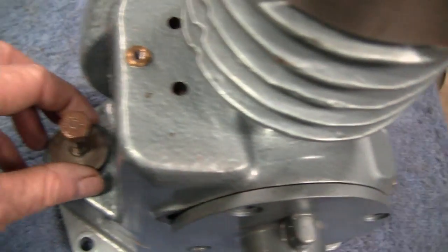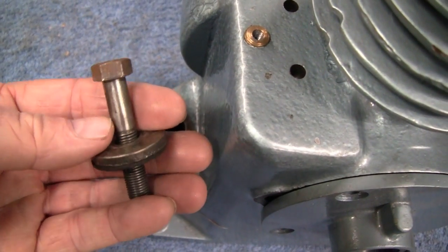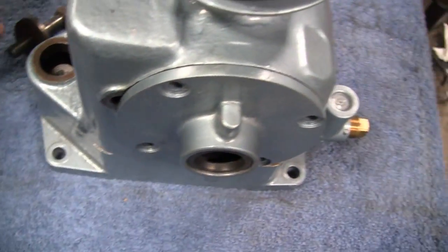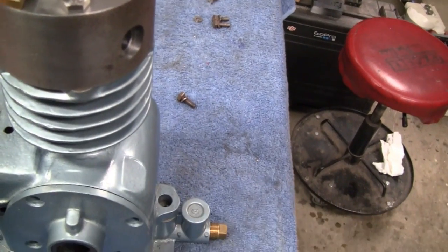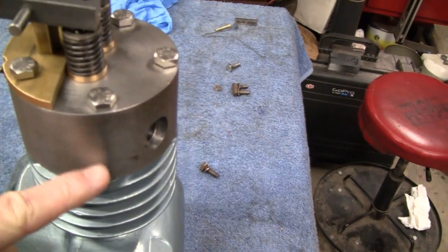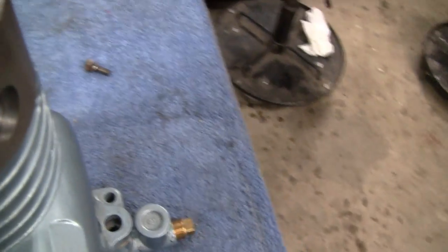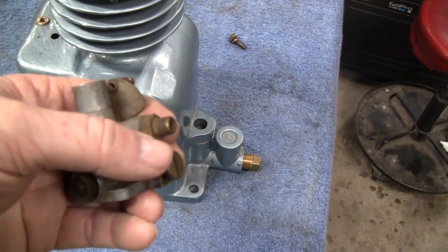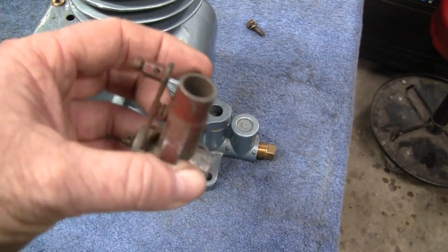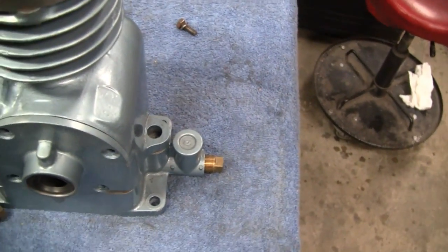You had the four bolts here, then the bolts here holding it down — you see the rust on there? It's a special bolt, you're not going to go buy one already done. So what I'm going to do — I'm going to nickel plate them. Eventually we want to nickel plate the head too so that won't rust, and also this carburetor here. I'm going to do these to practice so we know what we're doing when we come down to that.